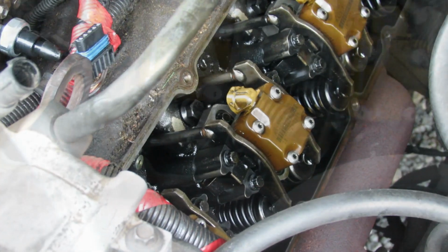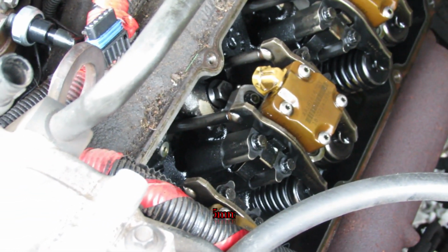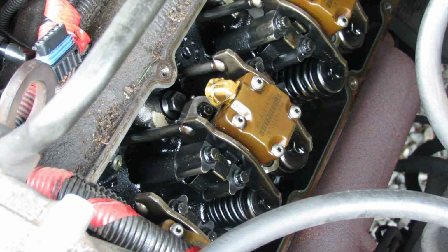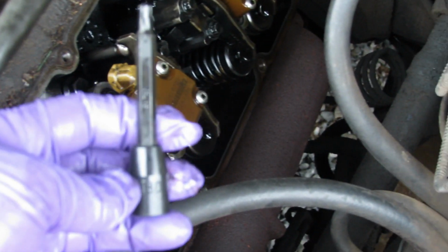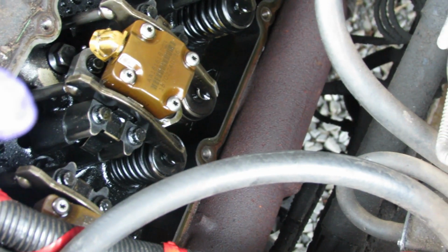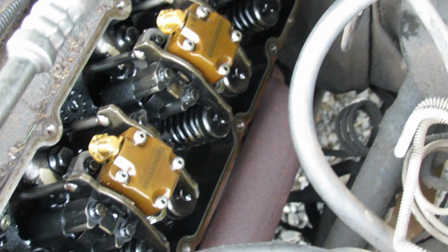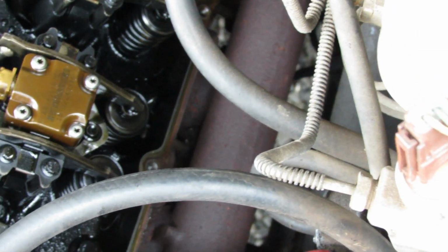I've gotten all the little oil deflectors removed from the injectors and the bolts. The closest thing I found was an Imperial 3/16, and I'll put down below what that is in metric, but I didn't have that. I also found that I had this Torx drive, T30, and that did really well to just help unscrew them. Once they were popped loose with the Allen wrench, I just unthreaded them easily with this little tool here, and so that worked really well. So T30 on that.